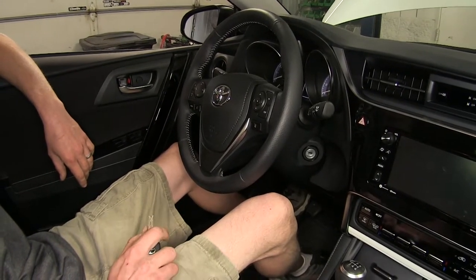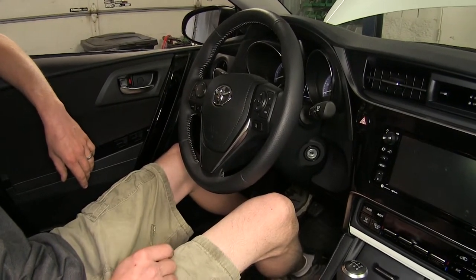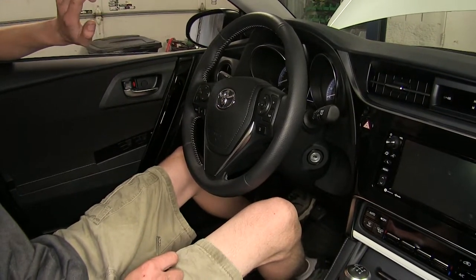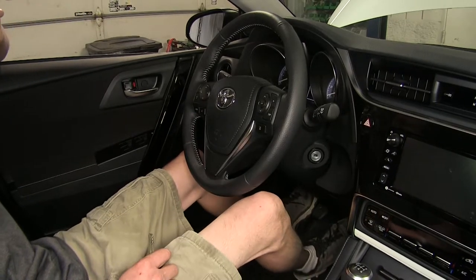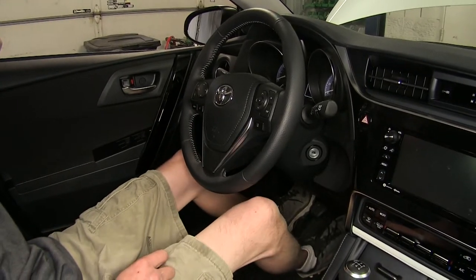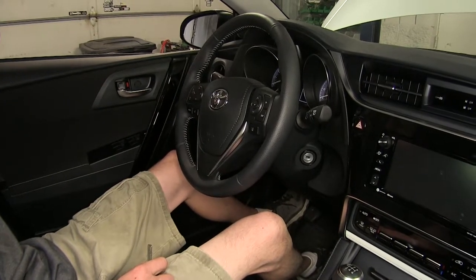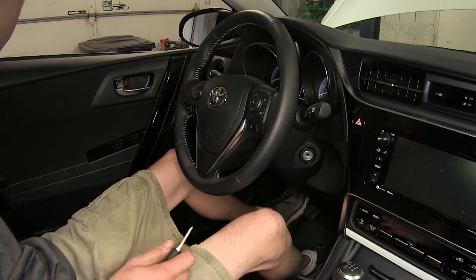That way, when our vehicle is being pulled behind our RV and our RV has its turn signal on and the brakes are depressed inside our vehicle by our supplemental braking system, we don't have to worry about our brake lights overriding the signal from our RV to turn our turn signal on.